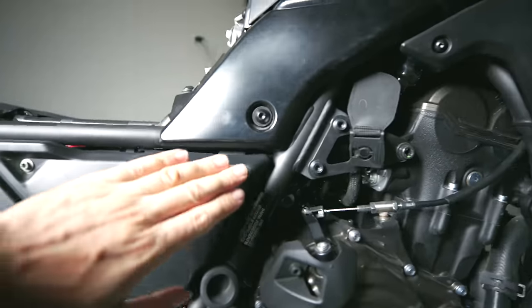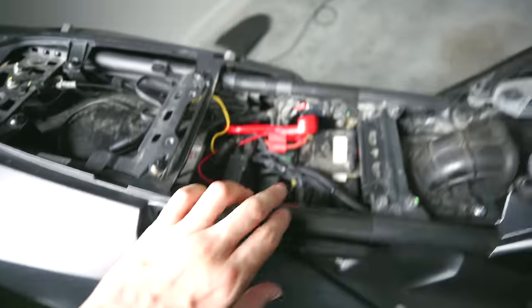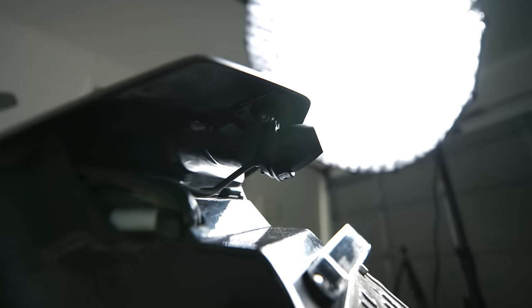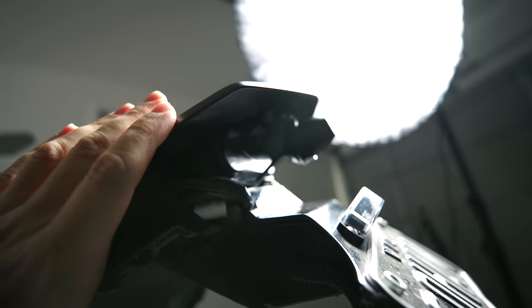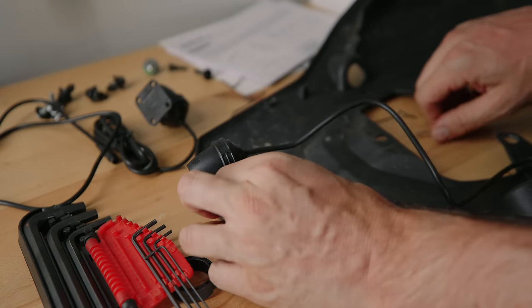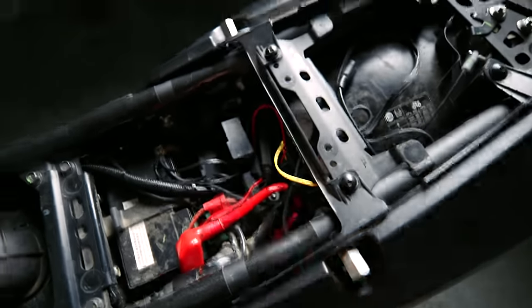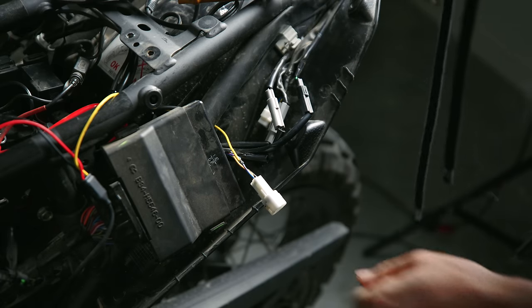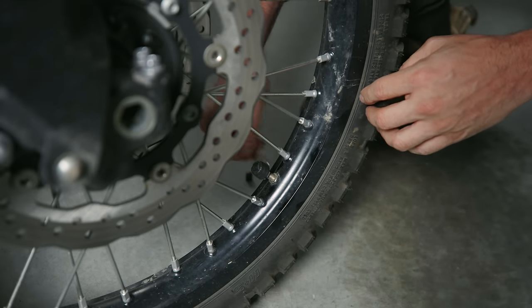I've got the GPS module mounted under here — it's just double-sided tape, you can tape it anywhere, just make sure you clean the surface. The harness runs all along underneath all the plastics and then comes up into the battery. The rear camera is mounted right there underneath the plastic guard. I might sneak it in a little more if I can still get the field of view. You have three cables coming out the back to the battery: positive, negative, and a yellow wire for accessories to trigger so the unit turns on when you start the bike and isn't on all the time. I tapped into my parkers circuit since I run LEDs all around and have enough headroom for the extra current draw. The tire pressure sensors just screw on with a lock nut on the back — pretty easy to install.